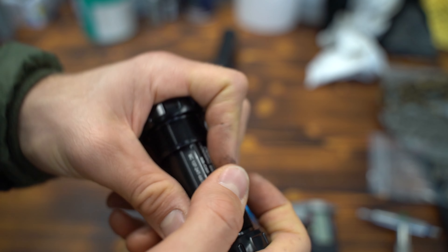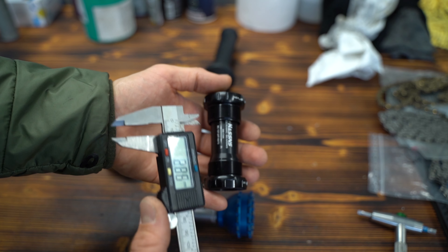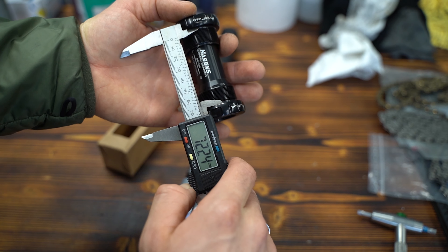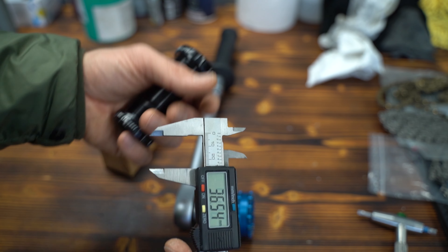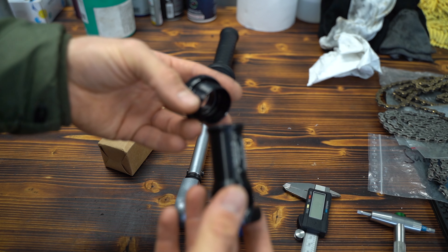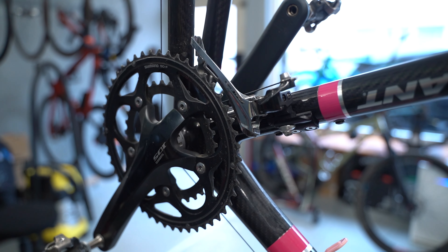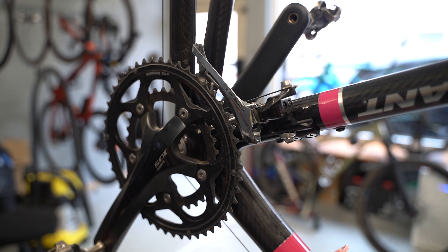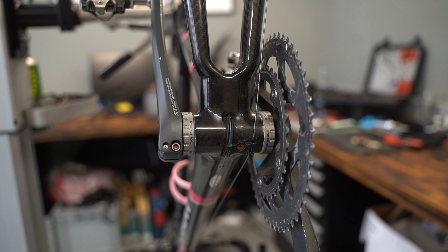But then what I realized pretty quickly is that if you push it all together, because we have a 68 millimeter bottom bracket shell with the road bike — if you take the measurement here we have 72, which means 73 if you want to be precise — there's actually no possibility to bring it further together, which means we can't really use it with the bike frame I intend to use it with. And that would be my vintage T-Mobile Giant TCR over here. That's quite a bummer because I was looking forward to it, but of course I made sure we can use it anyway.